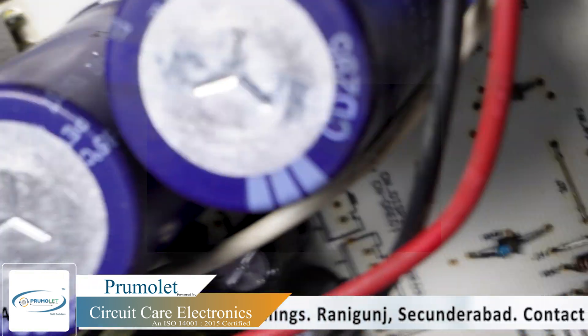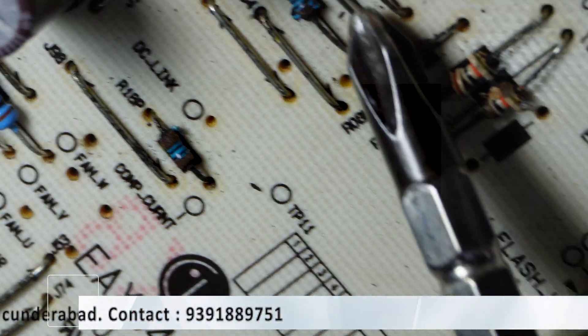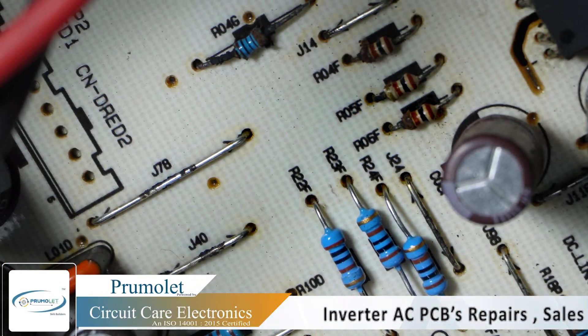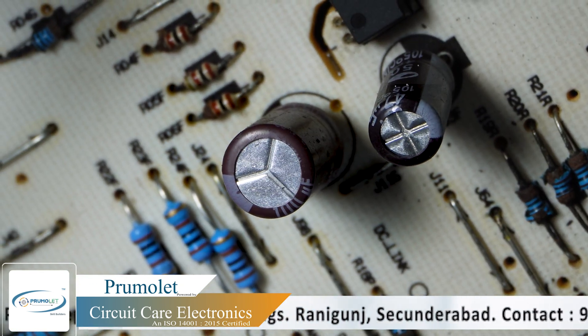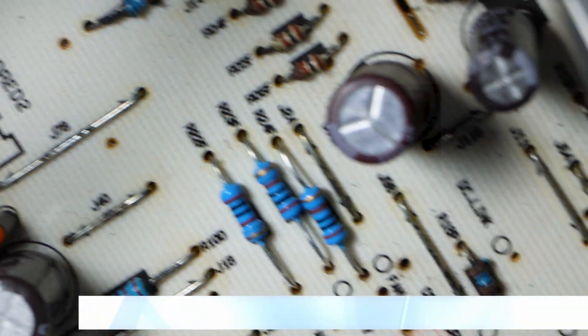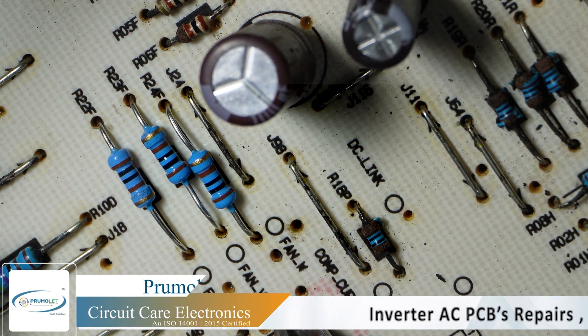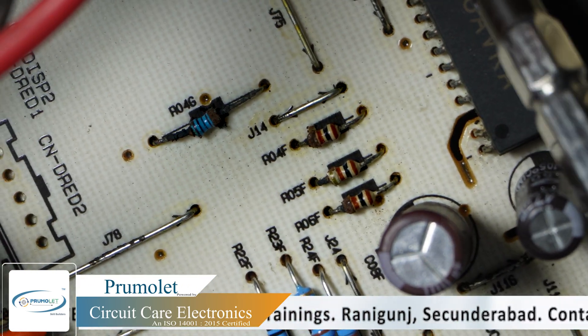You can see how the components got damaged — they are looking rusty. These three are completely damaged. These are the lines going from the controller to the IPM. You can see here: fan U, V, W — these go from the controller to the IPM. This is the fan motor drive. After doing all this, we are getting an error of compressor seized.